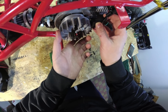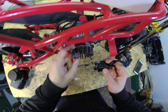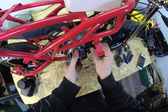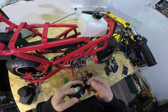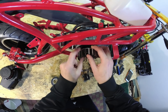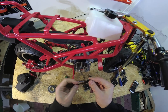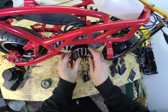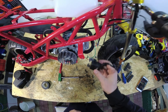Not too close, not too far. My advice is - you will see on the flywheel there are magnets, so the coil actually sticks to those magnets in this position. You can move the coil away, take a black tape and put the tape on to cover the magnets. We will do two layers of the black tape and cover the magnets.